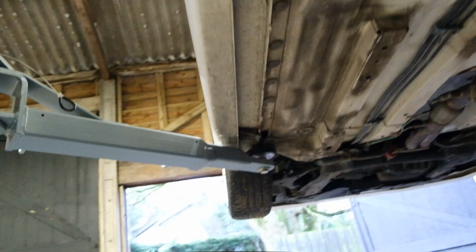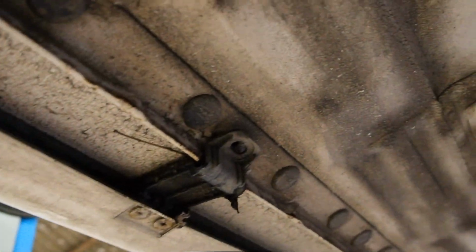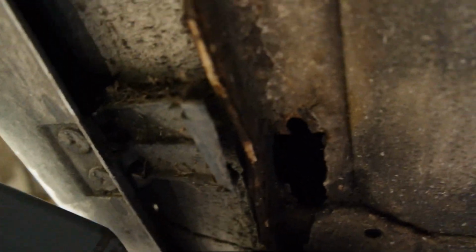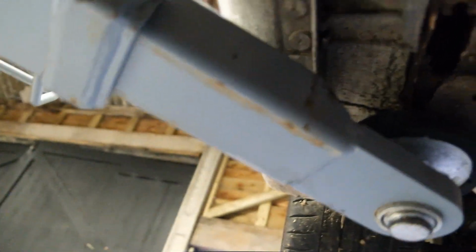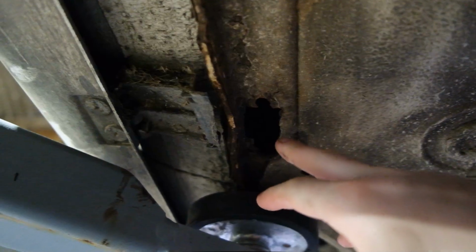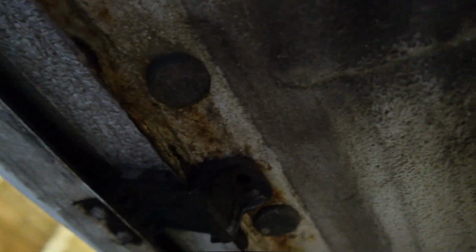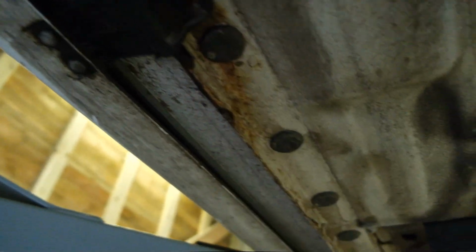Okay, so to start by getting this side skirt off, you want to make sure that these clips are not in. There's a few of them alongside the car. That one is completely gone off. Another thing this could have been is where that was clipped in up here, and it was getting water in through the clip, so that could be another possibility. I've only just thought of that one. But obviously check they are all off as well.